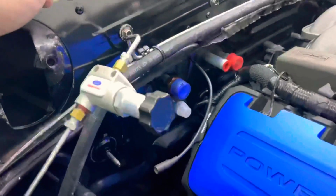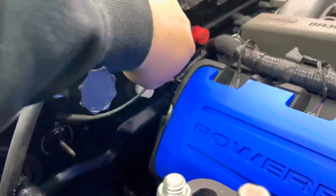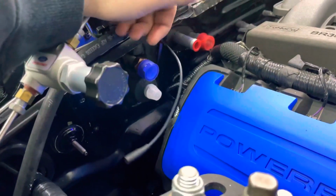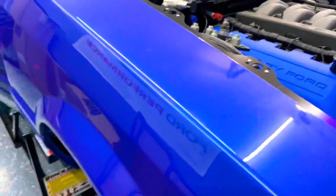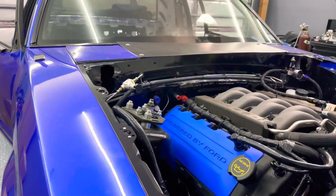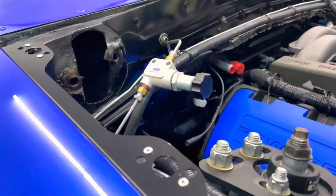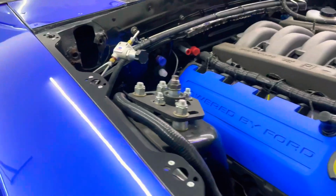So I got a new evap for the AC and the heater core right there with the vacuum line that I got to hook up. That way you can control the vents. So that's all new. I'll need heater hoses to run, but I still will need the AC components that go into the engine bay, like the dryer, I believe. I do need a condenser, the compressor, and then the lines. And then I think I got to run the pressure switches to it, which I'll figure out later.